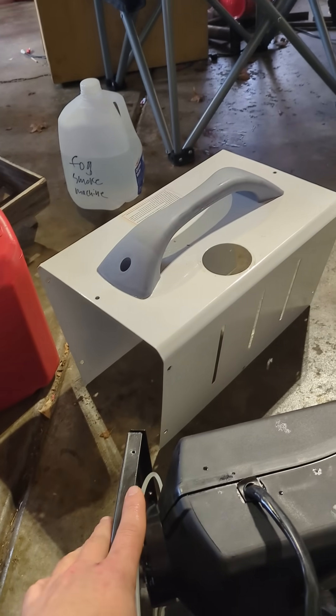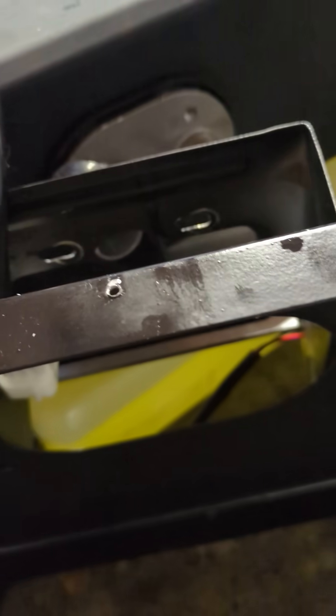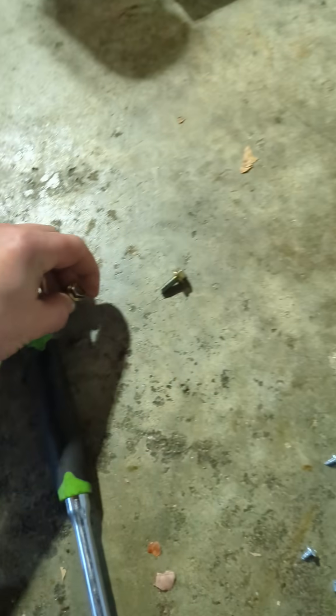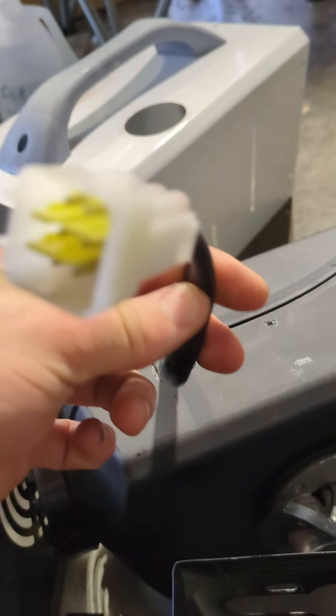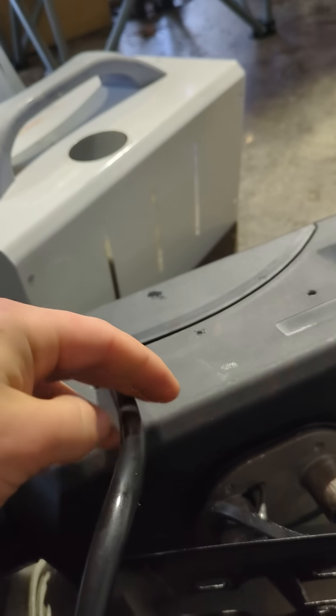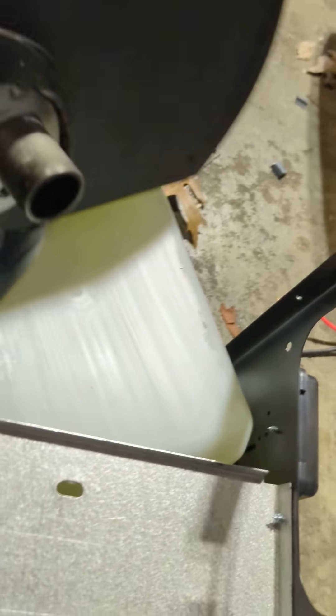What you're going to do is take the heater apart. If it's one of the ones that's in a case, take the case off. On the bottom there are four 10 millimeter bolts — go ahead and remove those. Disconnect the fuel line and try not to spill too much diesel fuel, unplug the power cable or whatever the cable is, and pull the heater body off the unit.